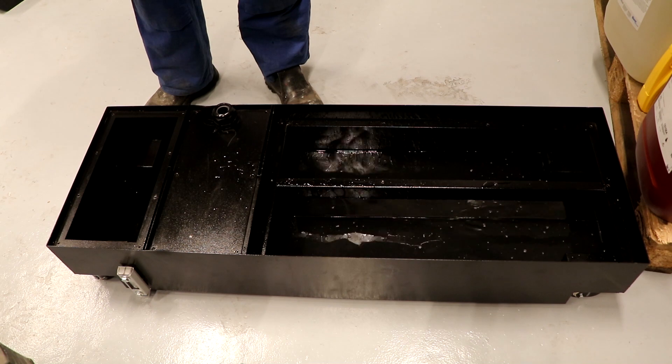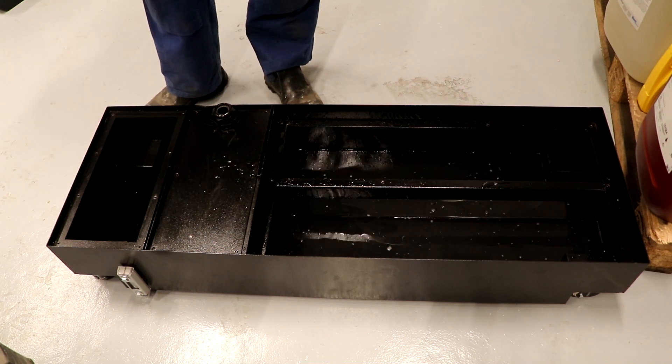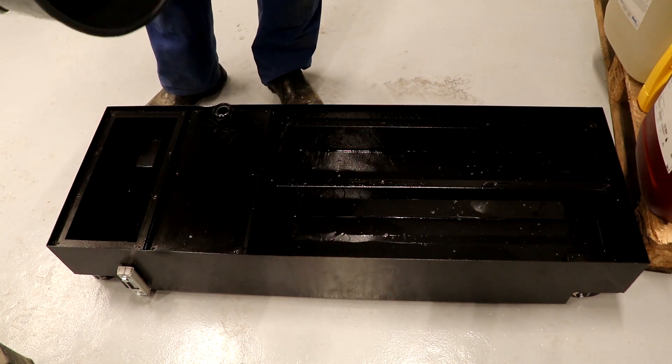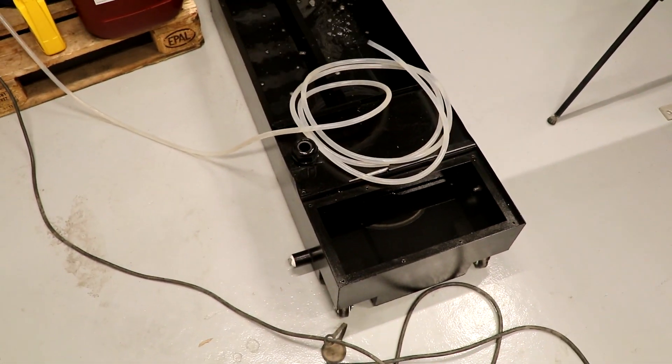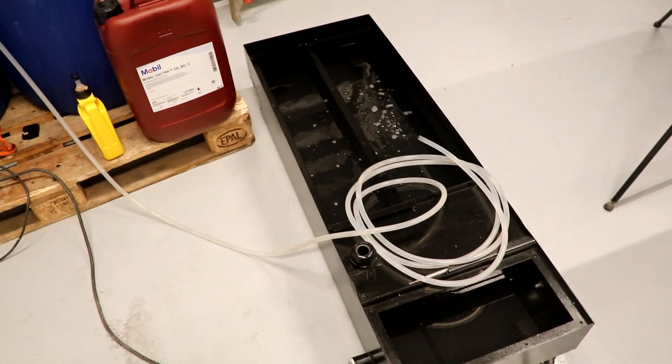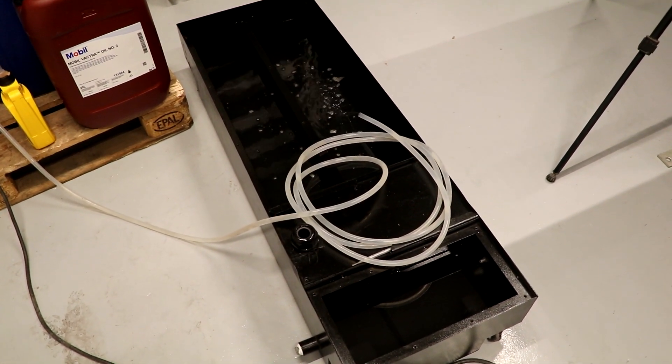Let that stand for a day, make sure it's all dry under the tank, and then do a 24-hour test. I came back today and the floor is still dry. So we welded the coolant tank successfully — it's still waterproof. We're now filling it up again with some DIY hacking solutions, but it works.